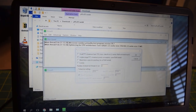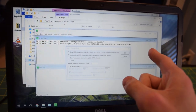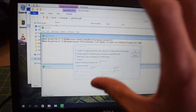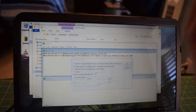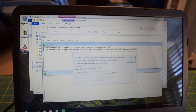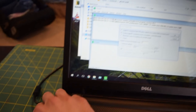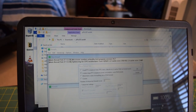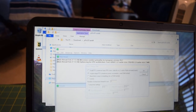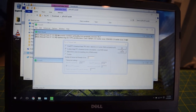Here's how the test is going to work: I have the screen brightness cranked all the way up to 100%, and while the laptop is unplugged I'm going to be running Prime95 on the CPU. This is a dual-core Celeron with about 8 gigabytes of RAM — I'll post a picture of the BIOS so you can get all the system specs. I'll be timing it with my phone and waiting for it to drain the battery all the way down until the laptop cuts off. We'll record that time and compare it with the older battery. Alright, unplug the laptop — click OK, crank the screen brightness back up to 100%, and go. Test with the new battery.